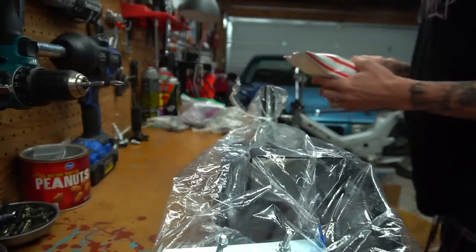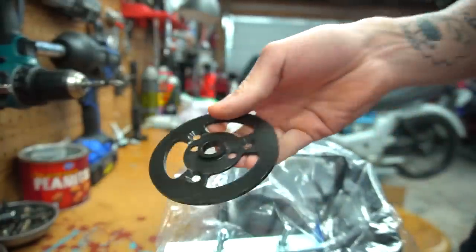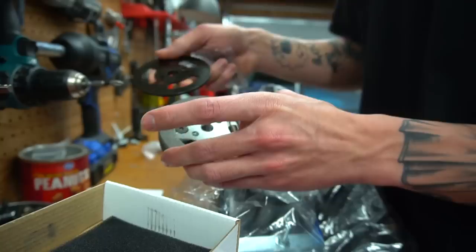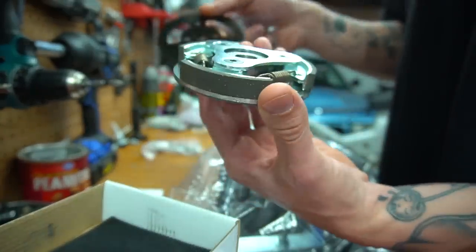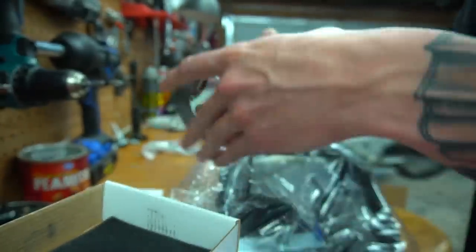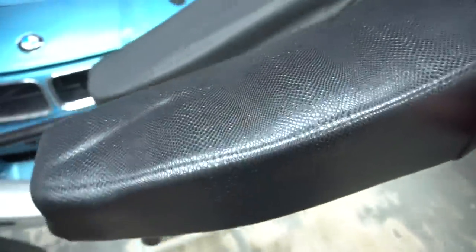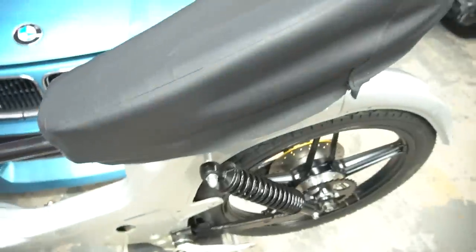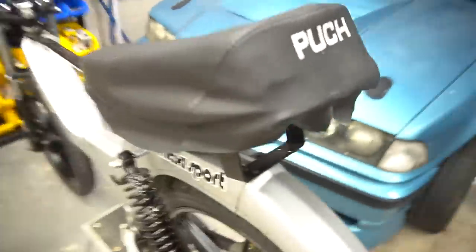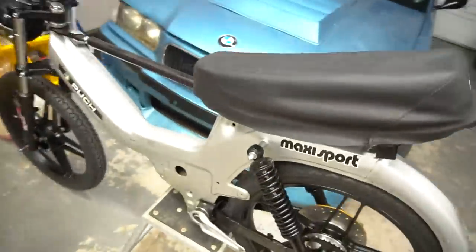More packages showing up — we got our kickstart clutch plate, and in here is a jammer clutch. This plate adapts for kickstart use, so we won't need the standard clutch plate you'd use with a clutch lever drop-start. Also got a new seat — I didn't really need one but it's cobra skin so I went for it. I liked the old one because it had the Pook logo, but those seats have a metal seat pan so you can't staple the covering — you have to glue it — and mine was cut up and ripped all around.